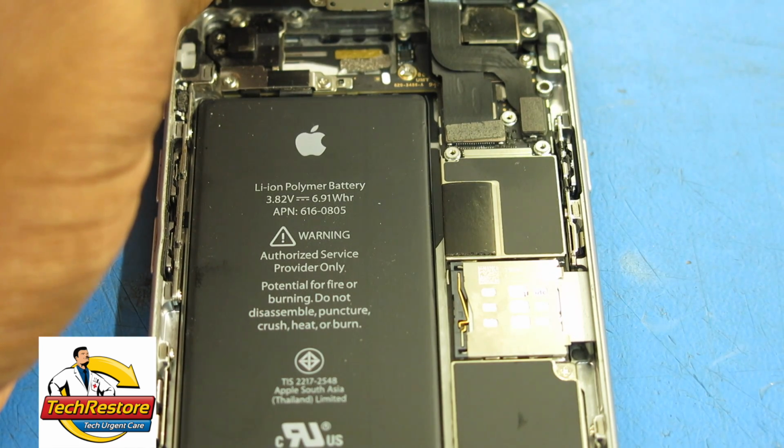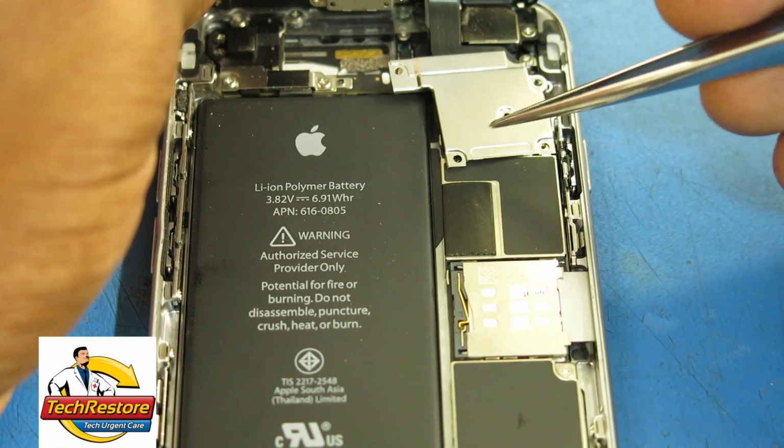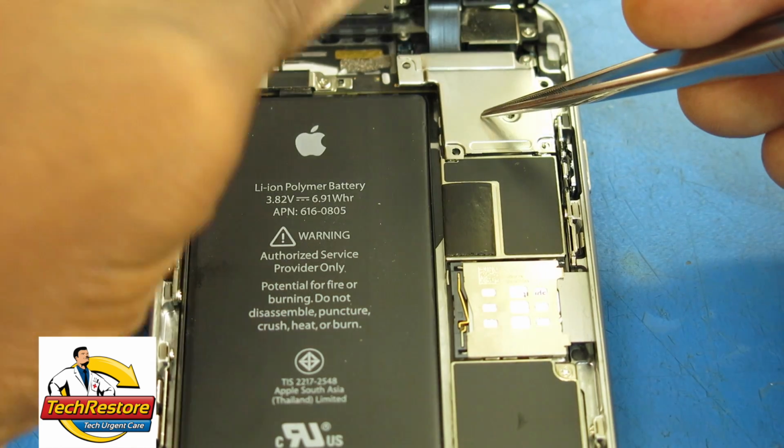Place the display cable connector shield in place over the connectors. Screw in the 5 screws you removed earlier. The longest screw fits into the top right hole.